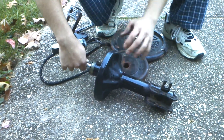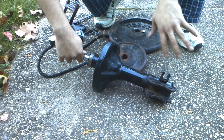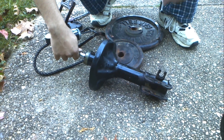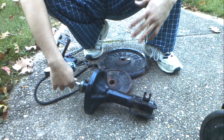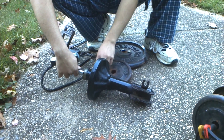In the demo I just did, this shock is running with no pressure added — it's running at atmospheric pressure, one atmosphere. Factory shocks, when they come from the factory, come charged with about 50 to 100 psi of nitrogen, and that provides an anti-foaming effect.